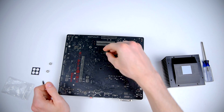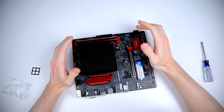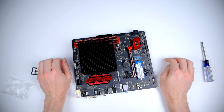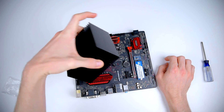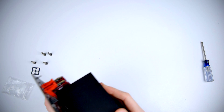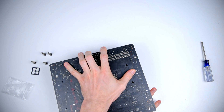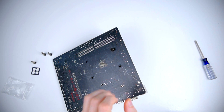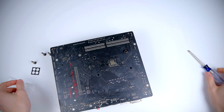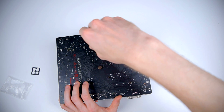So I put the springs on the screws and dropped them in the mounting holes. Then I needed to flip it over while holding all 4 screws in place. With it flipped over and the screws in place, I lined up the heatsink and set it down. It was at this point I realized Arctic had actually said to do it their way because their way works — it's pretty hard to tighten down screws when they're completely covered and upside down. So learning from the error of my ways, I followed their directions. I did my best to line up the patch of thermal paste with the CPU, then set it upside down on the table. You might want to support the motherboard with something so it doesn't fall off the heatsink.